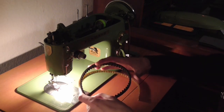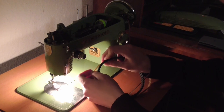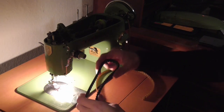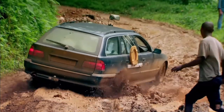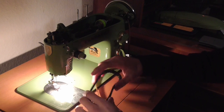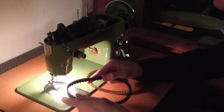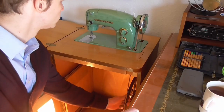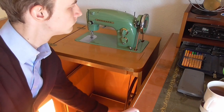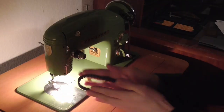The closest I could find was this toothed belt, which, as you can see, is quite a bit larger in size than this one. The teeth are a lot more pronounced and it is much stiffer. This thing is made to conduct speed and power, and for that reason it is very stable. By bending it and comparing it to this one, it's a night and day difference — and that is what makes this belt not want to work here. It's just too stable, and far too much power gets lost in friction of bending it over the tooth wheels.